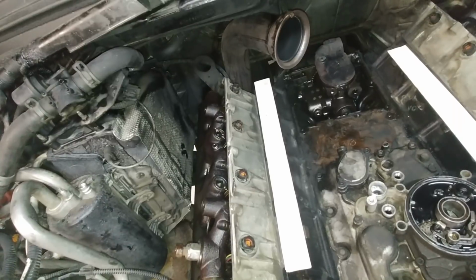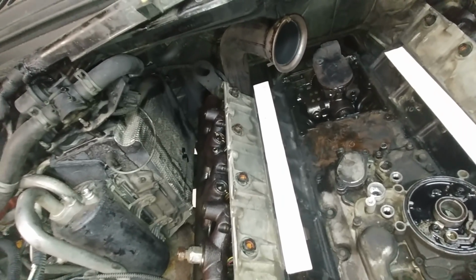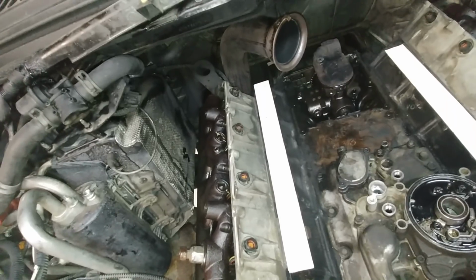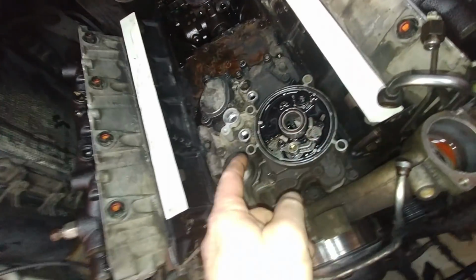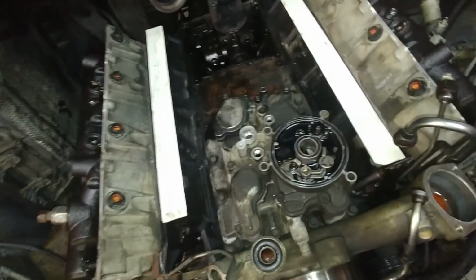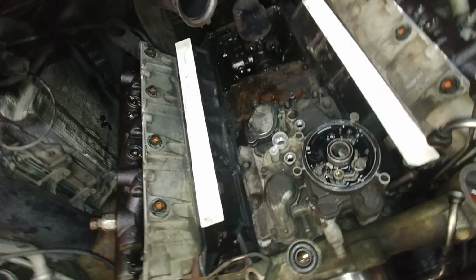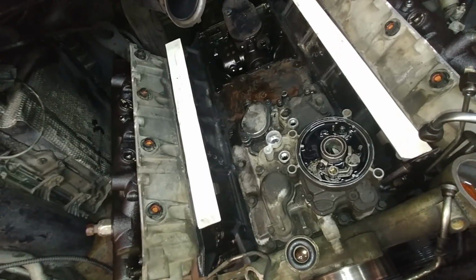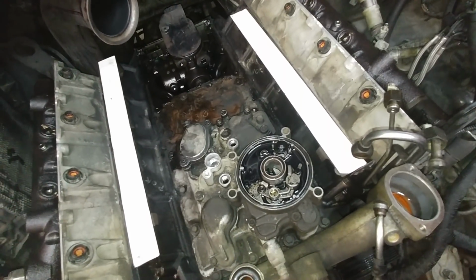So what I'm gonna do, we're gonna go ahead and yank the oil cooler. The numbers were good. I mean, the oil cooler is still good. If it's a factory or a Ford oil cooler, we can let it stay. I'll actually just blow some water through here. I'll blow it out. I can put some high pressure hot water through it and just, you know, just hell with it. It's not gonna hurt anything. Might as well blow it out a little bit, clean it. We'll get the oil out of it, and I might go ahead and spray.